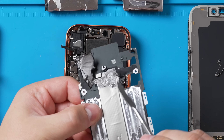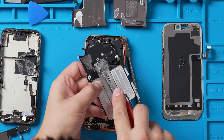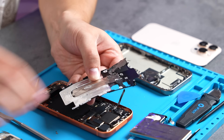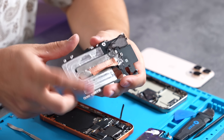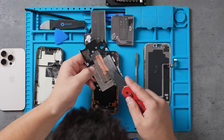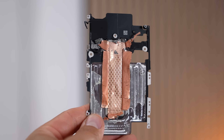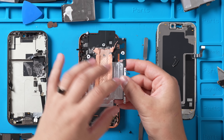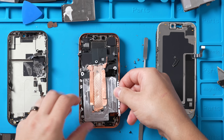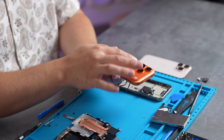Let's take this apart and see what's on the inside. That looks like thermal paste — and something like graphene or graphite. Oh look at that, just like Apple's animation — you can see the copper channels that the vapor flows through, like copper fiber channels. The vapor chamber spreads heat throughout, and this entire piece acts as a thermal spreader across basically the entire span of the phone.